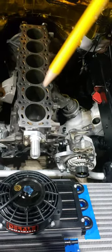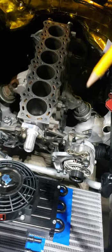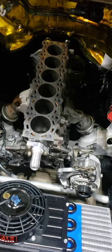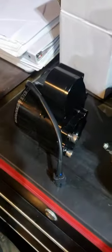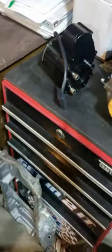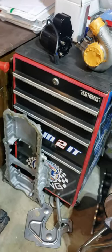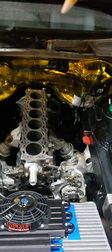The water pump is going to sit here, pull from the radiator, push straight through the engine, come out of the cylinder head, and go all the way back to the radiator. What I'm trying to figure out now is the Meziere 55-gallon-per-minute remote pump — it's really nice, but I don't want it flowing 55 gallons per minute at idle. So I want to design a series circuit that lets me run 8 volts to it, kind of like how the fuel pump ECU works on Supras.